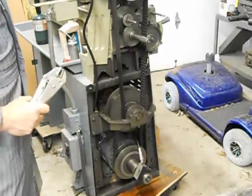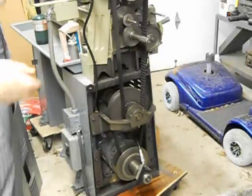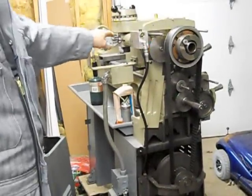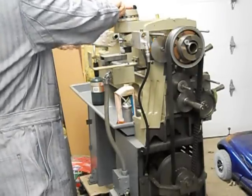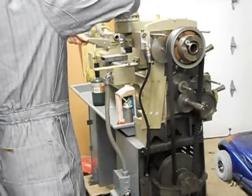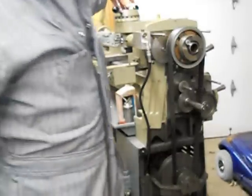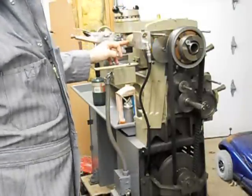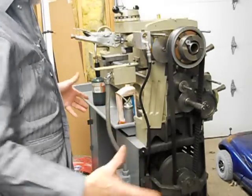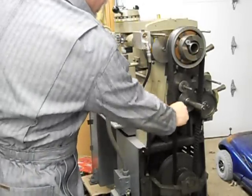That's the high end. We want to bleed it, and the speed is essentially at the low end. We keep it that way by clipping that vice grip right here on the cam at the low end level. This is the high speed. Bring it back here, and there's going to be some spring pressure that's trying to resist what you're doing — that's from the clockwork spring that's inside this housing. That actually counteracts the back pressure of the system generated by the spring down in the Reeves drive acting through the hydraulics. That's part of the adjustment process.